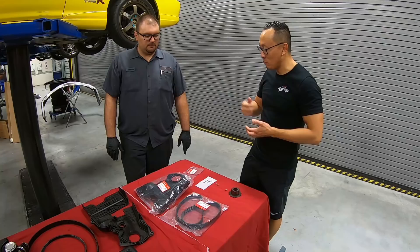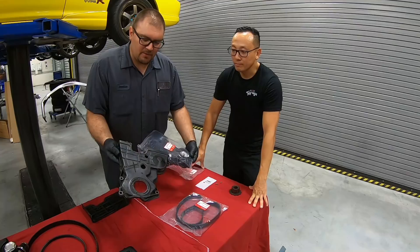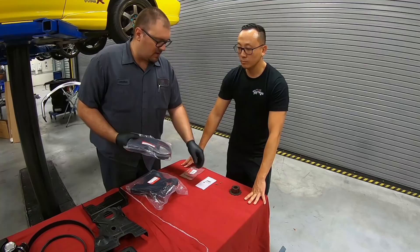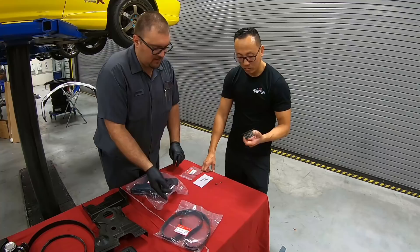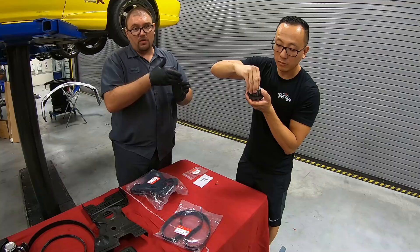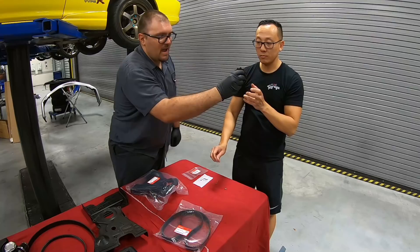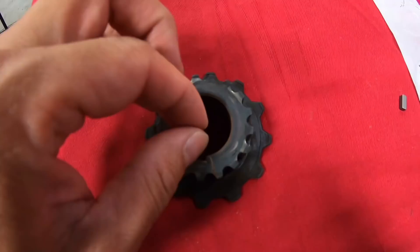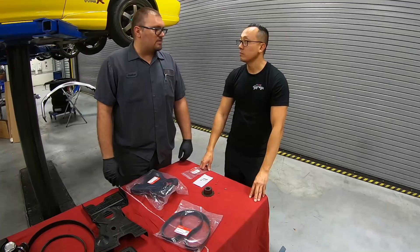We are right back to it, got the new parts. So we went ahead and we're going to replace the cover — it was damaged pretty good. We also are going to replace the timing belt because it got some damage from the guide being put on backwards. But the real problem making all that noise was the fact that someone fabricated a keyway and it was not machined perfectly to the grooves in the crank and the cam gear, causing it to rattle back and forth and make a clanking noise. The OEM one fit like a glove — you can see the clearance differences. All we've got to do is put it all back together like a regular timing belt job.